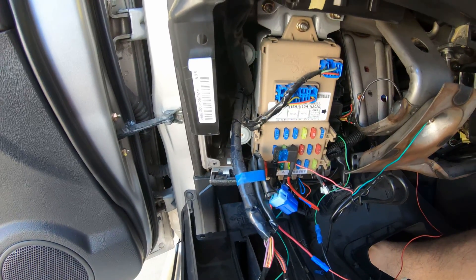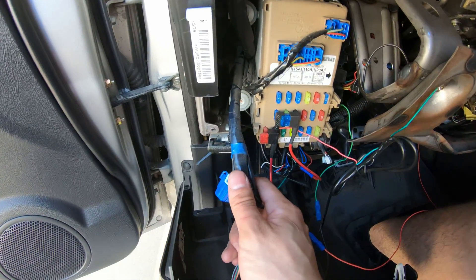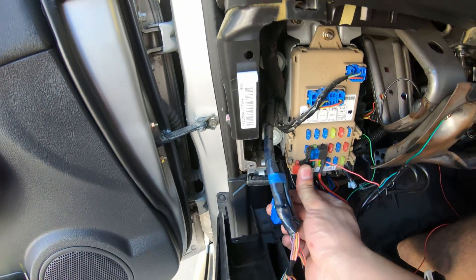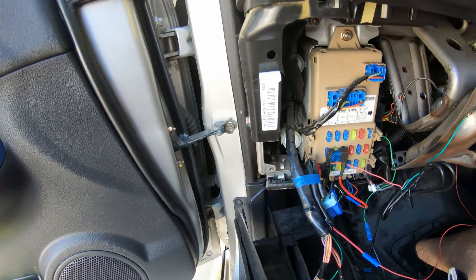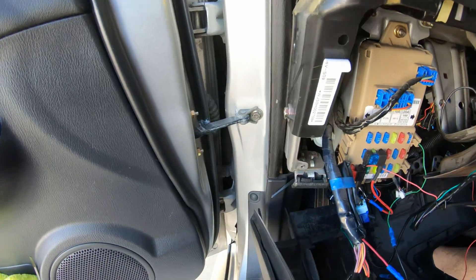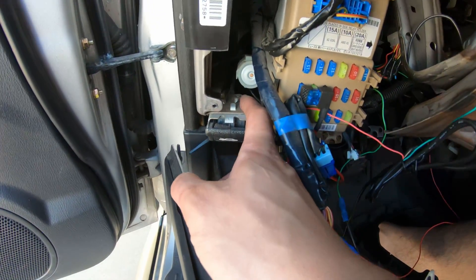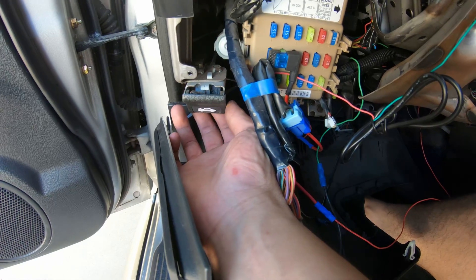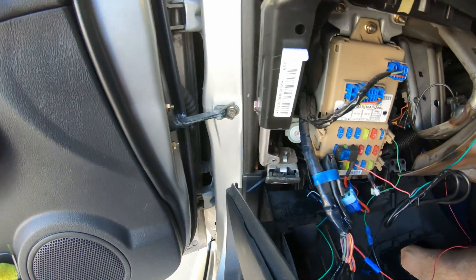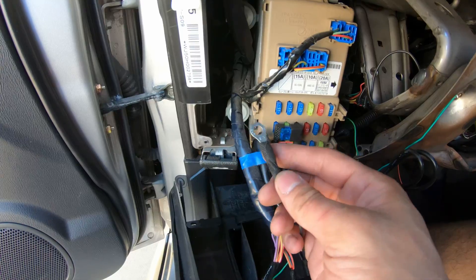So we're inside the car. To provide power to the gauge, the whole car is a 12-volt system, as noted in the user manual for the ECF1 or ECB1 for the GD chassis. I used the rear wiper slot — the bottom one in the fuse box — and put a 10-amp fuse on top and plugged it in there. For the ground, you want something metal connected to the chassis. I'm using a bolt right under where you pull the lever for the engine hood — I believe it's a 10mm — and that's good for the ground.